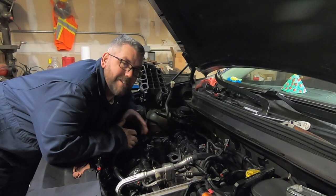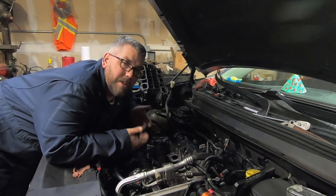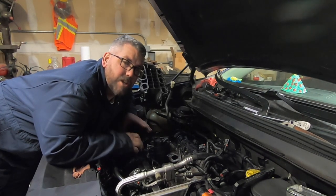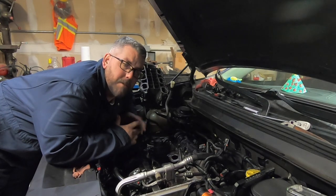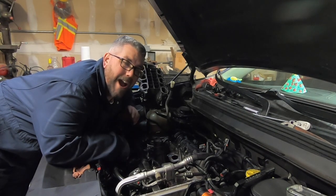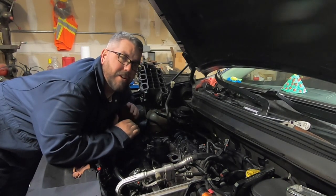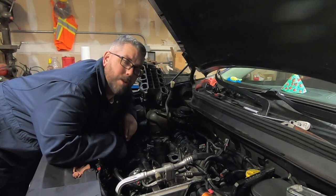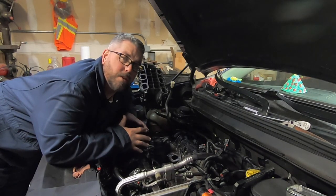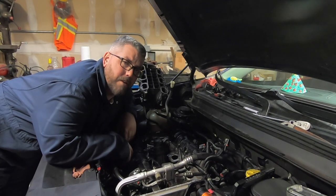With all our bolts removed we can start lifting it up and out of the way. When you lift it free it's going to make a mess in there, so be ready with some towels or maybe even a little fluid transfer pump just to get the mess out of the way. I highly recommend that when you're doing this job you make sure you're changing your oil at the same time and possibly your coolant — now is a perfect time to do a coolant flush, get the old coolant out and get new coolant in.